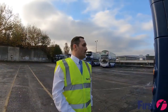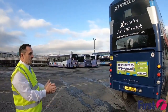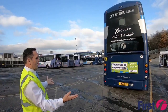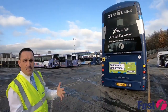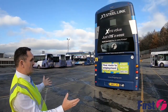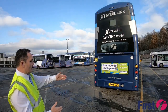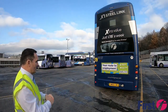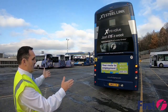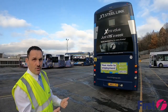When we get to the rear of the vehicle, at this point we can be taking note that there's no obvious signs of the vehicle leaning, which determines that the vehicle is looking okay. If it were leaning, we need to determine whether it could be a flat tyre or whether there is a problem with the suspension system on it. But it's looking okay on this one. The number plate is in good condition and it's illuminated. We're checking the hazard warning lights, we're checking the tail lights are working, the reflectors are in good condition.